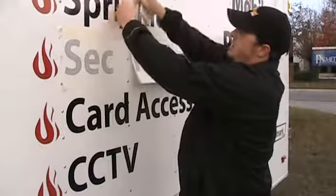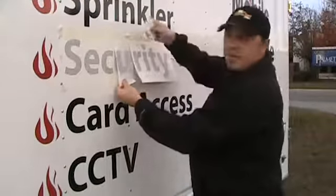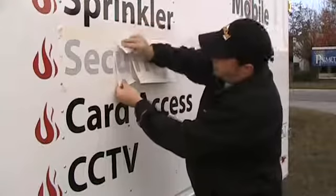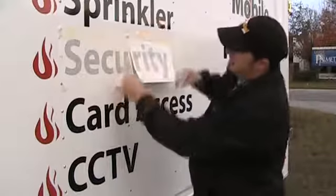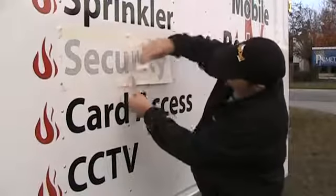So the next step I have here is I'm going to lay over this rivet. I peel the paper back and take it completely off. Follow my same rules, starting from the middle, applying even pressure. You may have to work around another rivet as well to make the pressure work. So you do everything you can, isolating that rivet, pulling the vinyl tight down in this corner, and working your way to the rivet. And you can actually just go over the rivet with your squeegee.